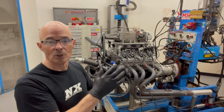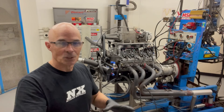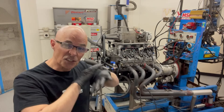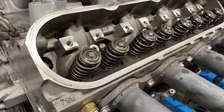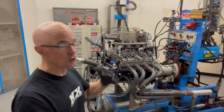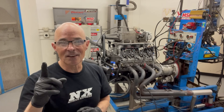But I had one problem — these factory 706 heads are terrible. Not all 706 heads are terrible, just these. When I got this one from the wrecking yard it was damaged. One of the rockers was glued in place, the hole for the rocker stud was wallered out, and it was just in a state of disarray. The other one had broken push rods and all kinds of stuff. A couple of the ports were filled with carbon. Rather than just replacing the springs in these heads, I decided to put different heads on. I had 799 heads that came off of the 5.3 L33 — they already have the valve spring upgrade. I'll swap those heads first, document the difference, and then install the camshaft.